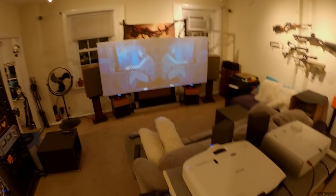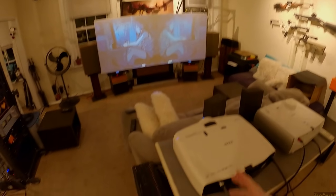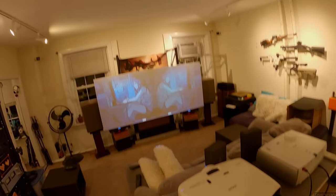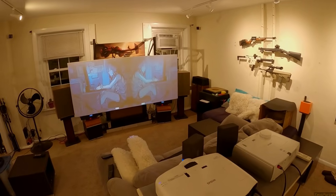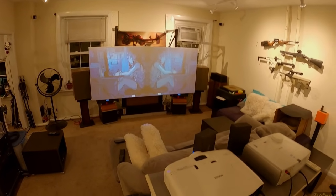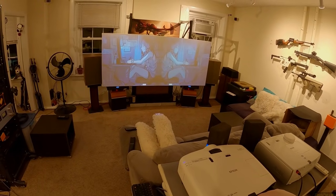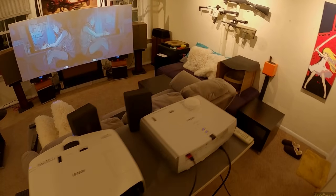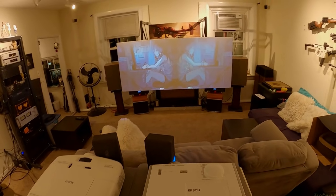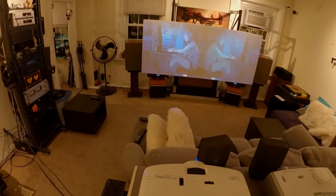Here's important advice: when you shut off a bulb projector, the fan keeps running for 30-40 seconds to cool the hot housing. If you lose power while the projector is running - a blackout - that's bad. I highly recommend a UPS for anyone running one of these. Without the fan cooling it, that bulb just keeps getting hotter and hotter and can explode. The old one had a mains power switch you could flip in an emergency to kill power cleanly, but they removed that from the new model.